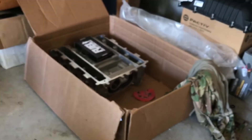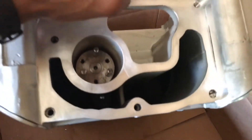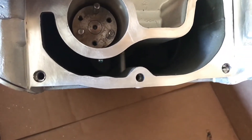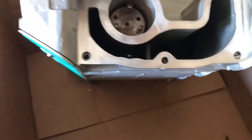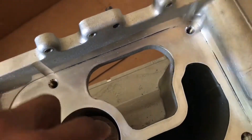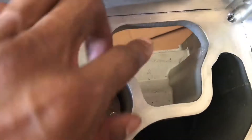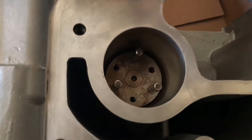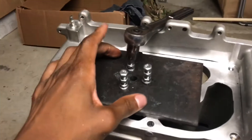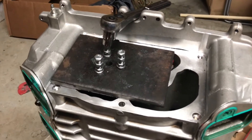I'm going to have to do the LSA itself — it was a very messy job. Obviously I need to get these rotors out, and I don't have a special puller for this. I saw a couple people make one with a little plate: put the bolts in each hole, run them through the plate, have a nut on the other side tightening, and it'll slowly pull it off because it's just pressed on. So I'm in the process of removing the front hub that's pressed on the rotor package.